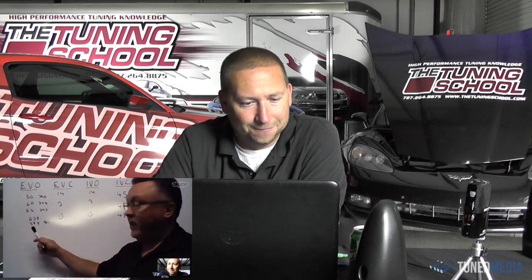So what are you going to do with your camshaft? Because this is a win-win. Anytime you can run less exhaust lift and make more power, you're going to be easier on parts. But then people may see a positive displacement supercharged cam from us. It's 595 exhaust lift. They're like, well, that's not enough exhaust lift to make power. Because they're an internet expert. And it's like, well, you should really back-to-back test that on a dyno and get back with me. That's a good answer right there.